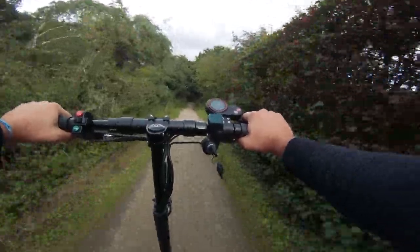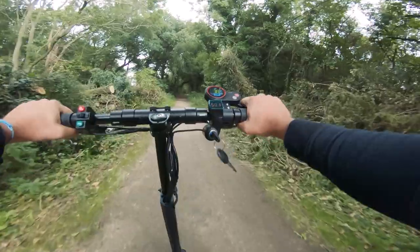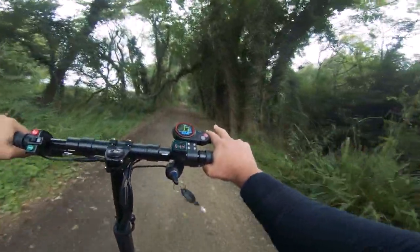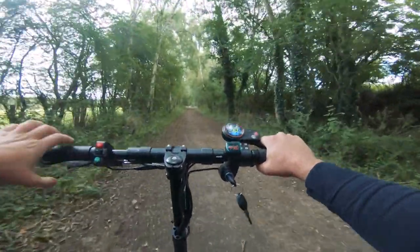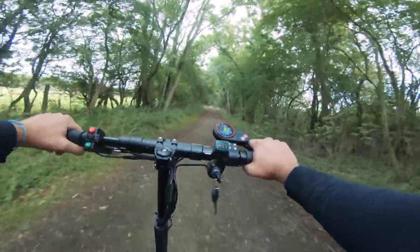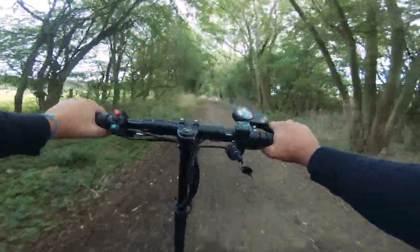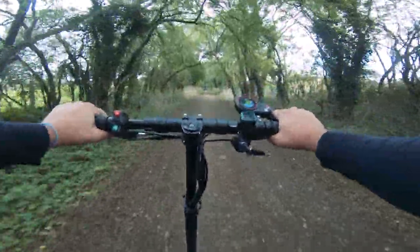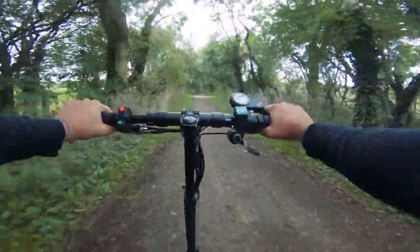And it wasn't completely fully charged. So with a sag at the minute, we're around 50 volts. So this obviously sags in that gear, 1.5 volts. I'm more than likely going to put slime in these tyres. I know they're big and chunky, but there's still a possibility to get a puncture, and that's not good when you're tens of miles from home.